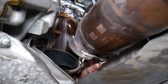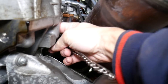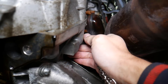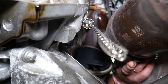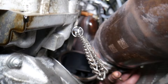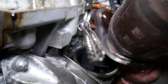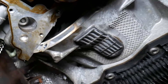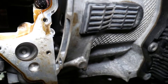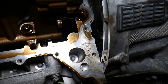After that, I grab the pin tube — that's the tool we'll be using. Now things get a little more complicated because I have to find that hole with the tube. I found it on the first try somehow, and you get it in about halfway. Then you need to find your TDC point: you turn the engine until that tube drops into the hole on the flywheel. Ours is already brought into place. If you look through there with a light, you can see the tube locked in place inside.